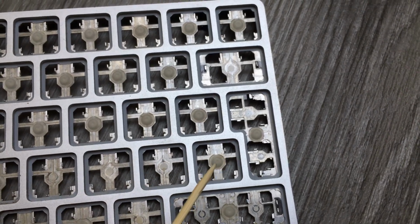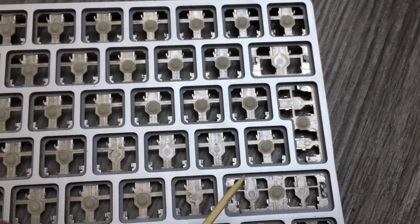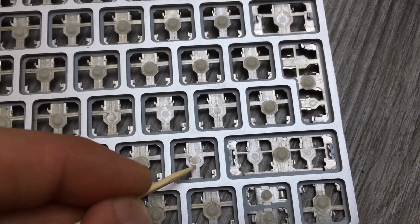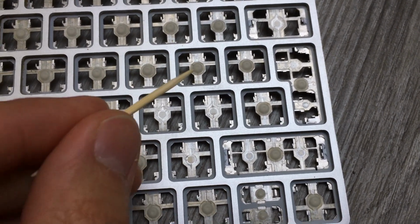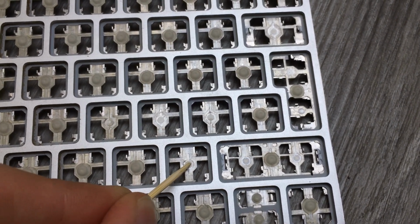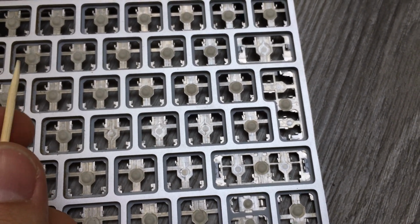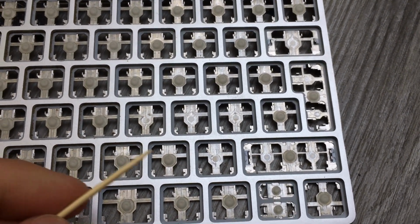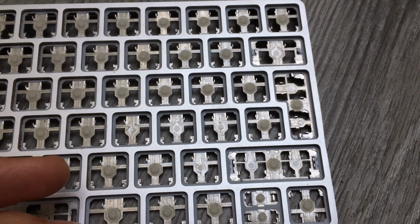But as you can see, some of these rubber nipples have been removed, especially the ones corresponding to the keys that don't really work. And I found out, I don't know if you see it here, that it looks like the circuit is either burned or rusty, and it happens here, here, and here. I am not really sure, I need to check and diagnose. If, after I have cleaned everything, these keys work, then I will continue cleaning the rest, otherwise I need to find a solution.